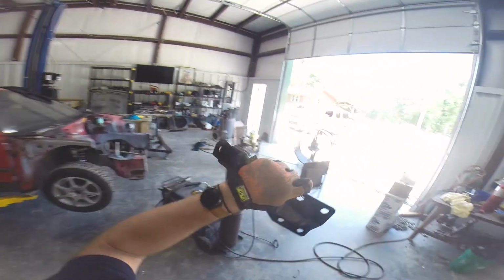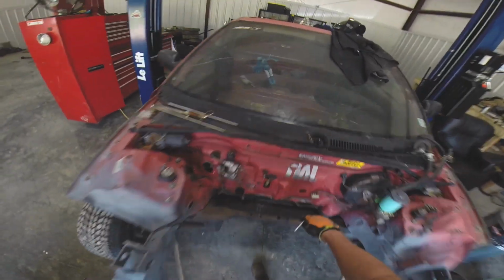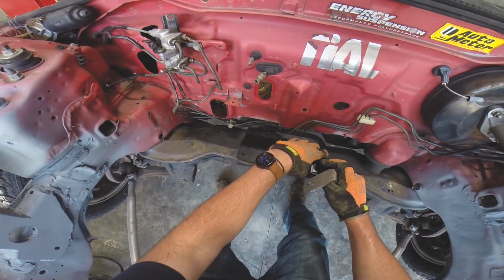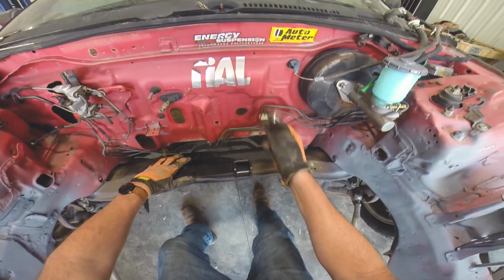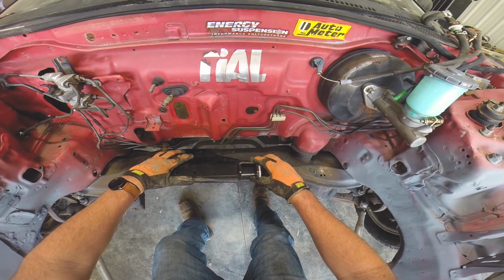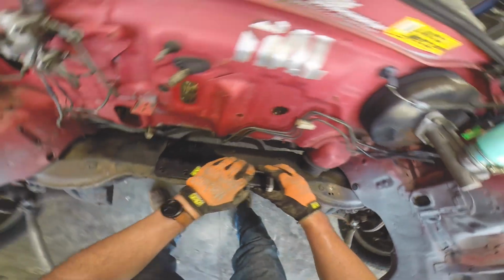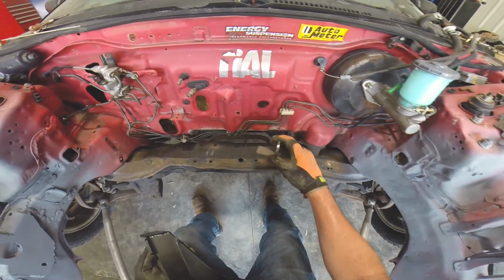I was going through the Hasport kit, figuring out what I need to do. I had this extra weld-on bracket, and I remembered it when I saw it, but I forgot it when I was doing the welding in here before. So what you've got to do, this goes on here, and you go ahead and bolt that up. This is actually a support for this, to give it just a little bit extra gusto. Once that's in there, you go ahead and tack that up while it's bolted together. We're gonna bolt through there, then take this up and finish weld that. So I need to prep this whole surface for welding this on there. So what else do I want to do?